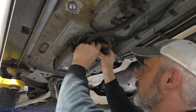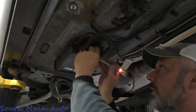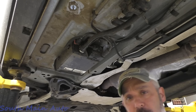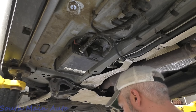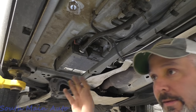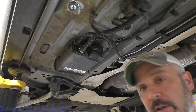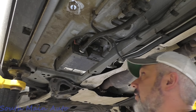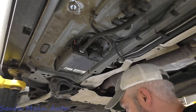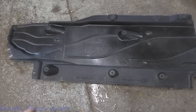I plugged it back in. You guys want to see if we were right or not. Let's try reaching in here — okay, there we go. Ta-da! Yeehaw! Alright, I wonder if with the circuit repaired the output test works. I'm going to clear the code — sometimes certain tests are restricted because of a DTC, but typically they say something like 'unable to perform test due to DTC.' Let me let it re-read the codes, I'll clear them out, and then we'll try that again.